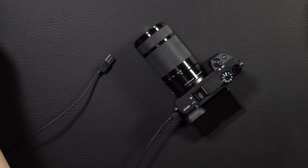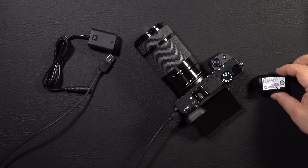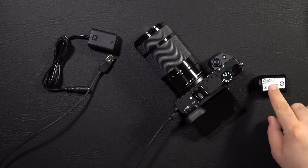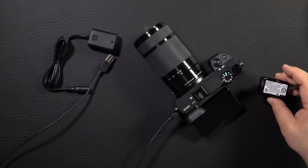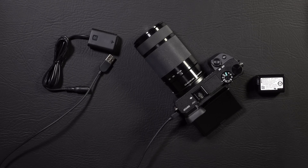There are a couple of things to note about powering the camera. If you go through the dummy battery, note that the original batteries are listed as 7.2 volt. When fully charged, the battery will actually read about 8.4 volts. So people have had luck with 9 volt battery packs. I would personally stick to providing somewhere between 7.2 and 8.4 volts.